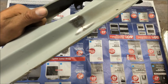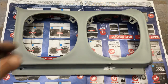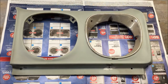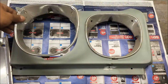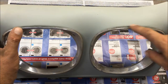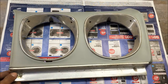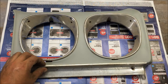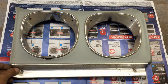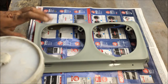Don't be scared to knock your epoxy off — it's gonna happen. Another thing: when you're doing body work, always have the trim accessible because you need to see exactly what's being covered. A lot of times you end up wasting your time on something that's covered by a piece of trim. Make sure you know what your trim covers.